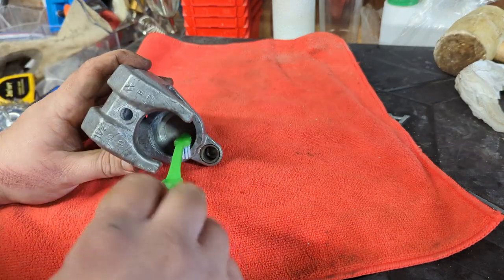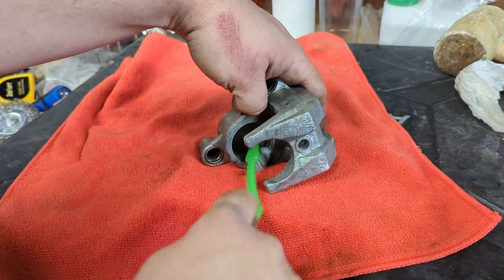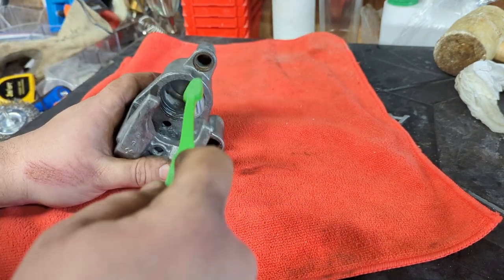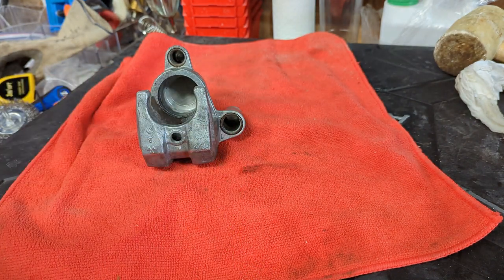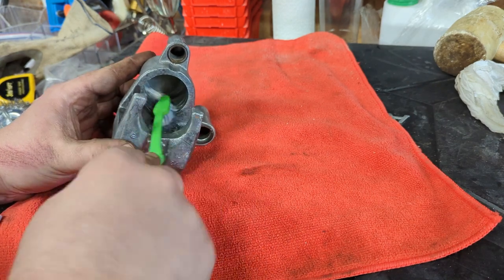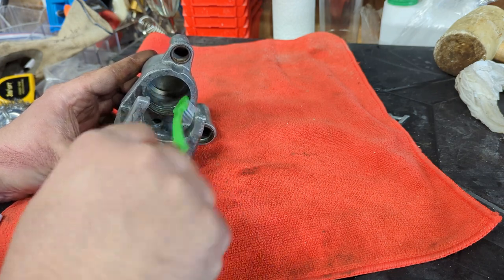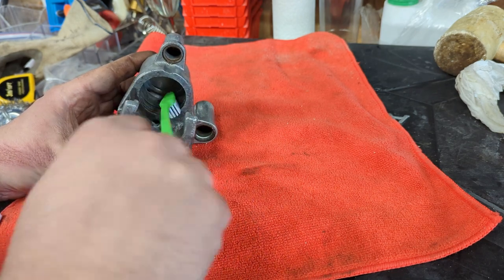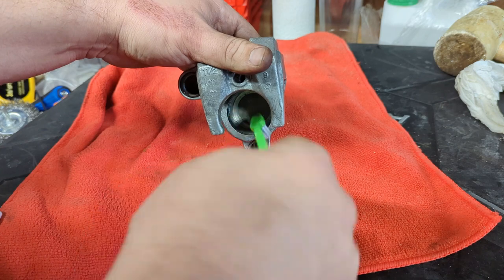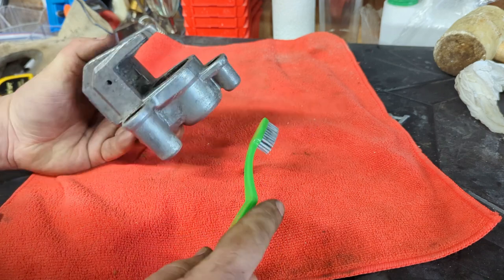Just a very light oxalic acid or citric acid to do this as well. There's just a bit of white corrosion inside the channels where the seals sit, and we don't want to trap that underneath the seals and let it get worse. Citric acid's preferred for aluminium, but it shouldn't matter for what we're doing right now, as long as we wash it all off fairly quick and don't let it sit. Because we do want it to eat the corrosion, just not the caliper.